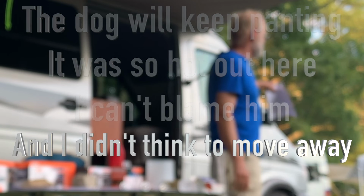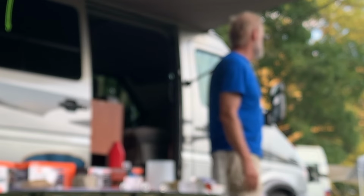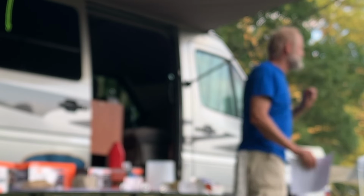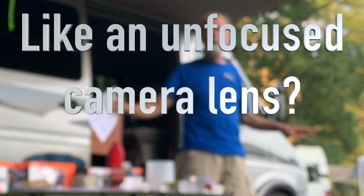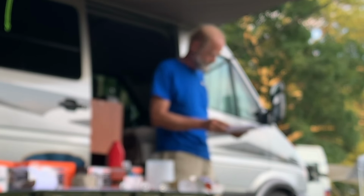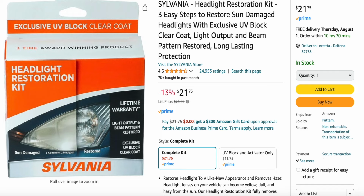Same thing here. If the filament, if the emitter, is not properly placed in the light source, and the light source is not exactly placed in the assembly, the optics won't work. Light will come out, it won't go where you need it. Remember that. That is at the fundamental basis of everything I have to say. The question you're all going to ask: how can I improve forward lighting performance? I'm glad you asked. At each level, you can do something for optimization.